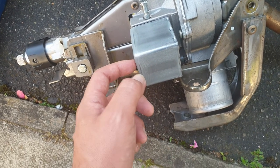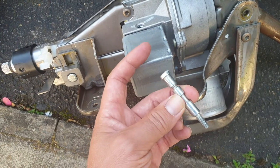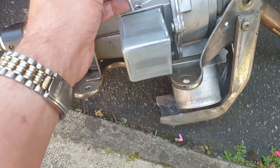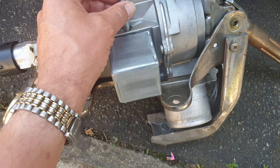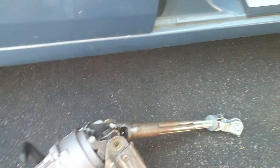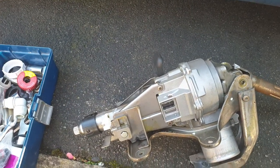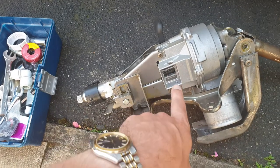This here is the steering lock. I can't use this one because it isn't programmed to my car, so I have to take my own off. You have to remove this bolt — it's a special bolt. When the steering lock is engaged it actually locks the bolt as well so thieves can't remove it. Also this seemed to be reverse threaded, so rather than turning left to loosen it, I had to turn it to the right to loosen it and remove that pin.